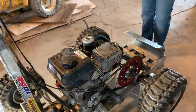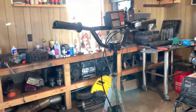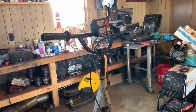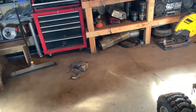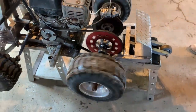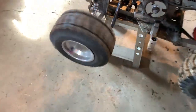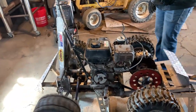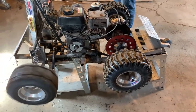All right, we got the chair off. We're gonna adjust the tie rods, and we might cut that off to straighten it. We're gonna cut the exhaust off. We got a little bit of pipe from that for now. We're gonna try to use a straight pipe. But we oiled the chain and the bearing, and it rolls a lot nicer now. The chain was so stiff, even with the front wheels. So it should run a lot better now. It should actually be able to roll freely.